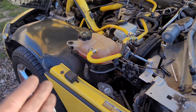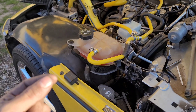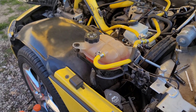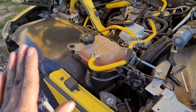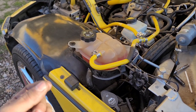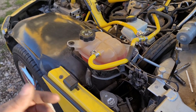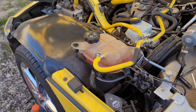For the LE5 engine: once everything is on, start the engine, let it idle for a moment, then rev it at about 2,000 to 2,500 RPM for 3 minutes. After the 3 minutes has passed, stop revving the engine, let it idle for 30 seconds, and check the cold fill line. If it has fallen below within the first 10 minutes, refill the coolant system and try it again until it has settled. And that will be it for the LE5.